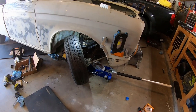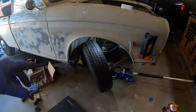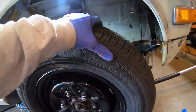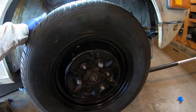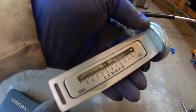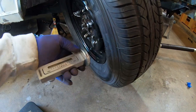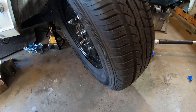I keep thinking I have too much caster. The truck is at stock height in the back — there's like two to three inches of lean. I've intentionally got the truck down to the ground so I can measure everything. I've been trying to measure the caster different ways. My bubble gauge — my trusty old tool — kind of went crazy on me. The bubble is too big. You can actually use this to measure caster by putting it on and turning the wheels 20 degrees, but the tools let me down.